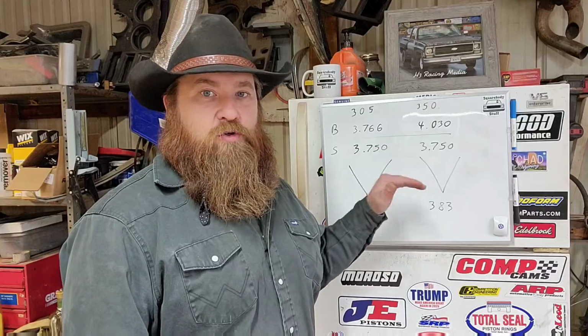So those are some of the basics of the 305 versus 350 discussion. I have been told in the past by certain gearheads that when I told them I had a 305, you could take 350 heads and put them on my 305 and I would have a 350. I'm not sure how that works. If you ever hear that, that's not how it works. You can't change displacement with cylinder heads. You can change compression ratio, but you can't change your actual displacement. That comes with your bore and stroke.